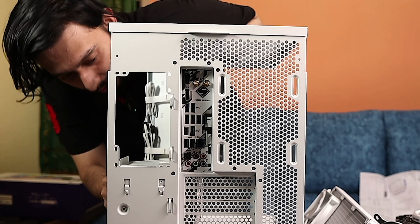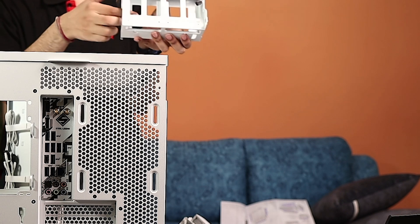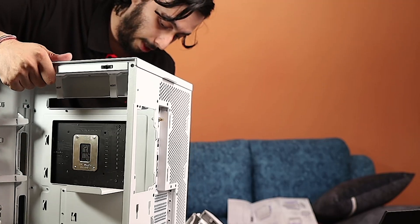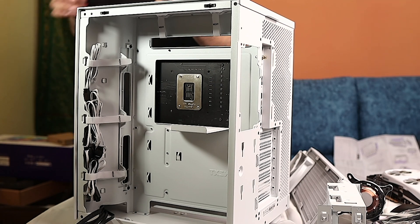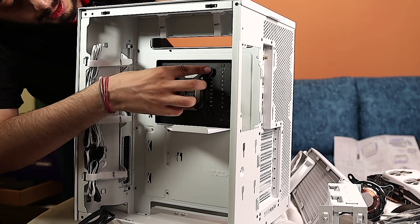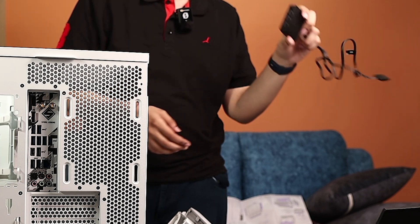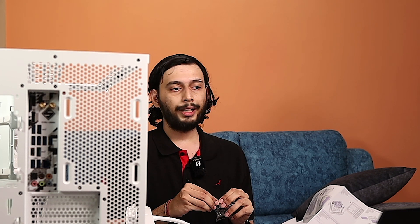There is more cool stuff here. We will place it on top — there is a box on top which is also a storage section. You can use a 3.5-inch hard disk or SATA SSD with a bracket. There is a slot on top, and here is the power supply. There is also a SATA SSD drive which we can remove or keep depending on priority. Opening the plastic: there is a SATA cable that must connect to the motherboard, a USB 2.0 header, a SATA connector, and a controller board. We will mount fans with these screws and washers.